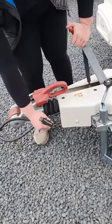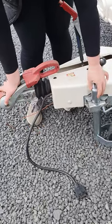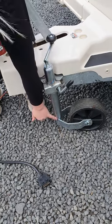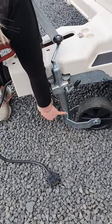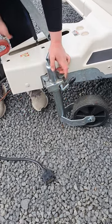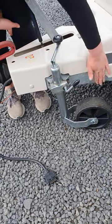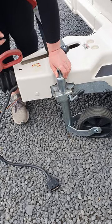You do have a standard 7 pin trailer plug as well. Once that's all connected up, you need to get your jockey wheel out of the way. You want to wind your jockey wheel up so it looks like it does now where these arms are slotted into these grooves on the side. That just stops your wheel from spinning around when you're towing. You can then undo this handle and pull the whole jockey wheel up just so your wheel is resting against the A-frame, then tighten it up out of the way.